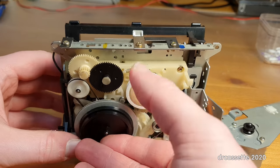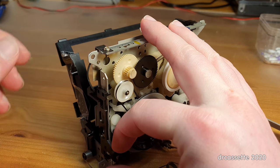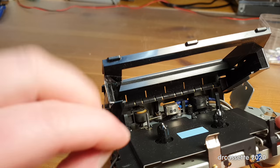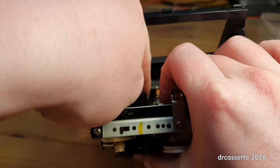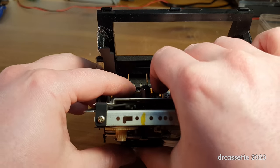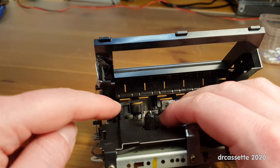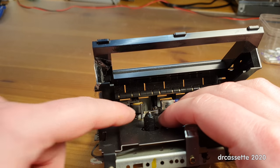The thing that you should not forget is on the other side. On top of the capstan goes a clear, transparent washer, and that is what keeps oil from coming out of the capstan bearing and getting all over the tape and pinch roller. Obviously you can't lose this washer, and when you're done fixing the capstan you've got to put it back. Since I did stick the capstan through the newly oiled bearing, it is now going to be oily as well, so I have to clean that before using the cassette deck for the first time.